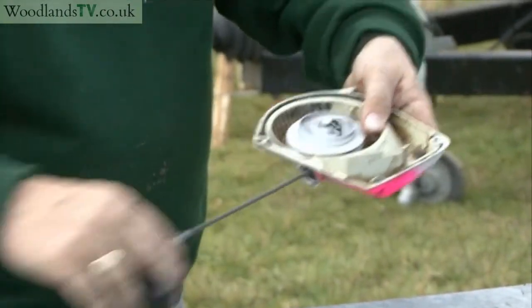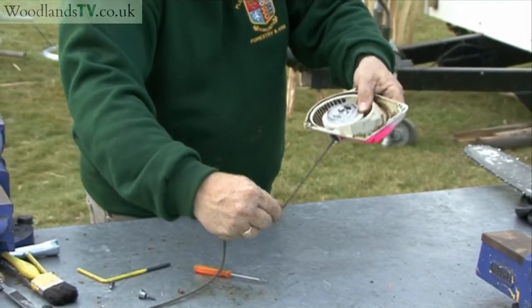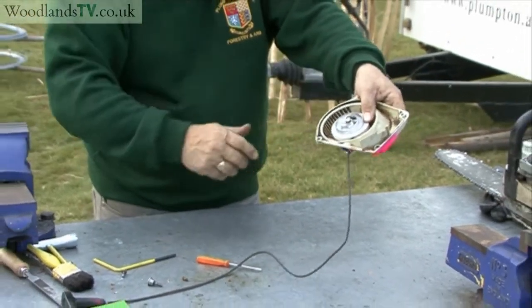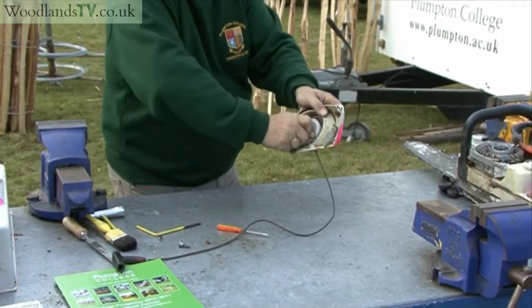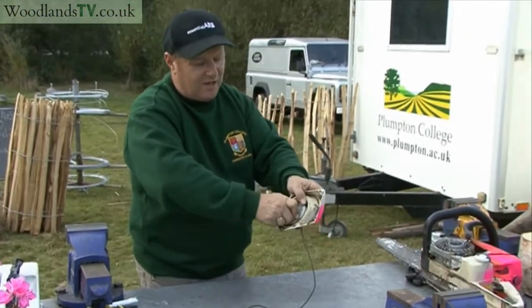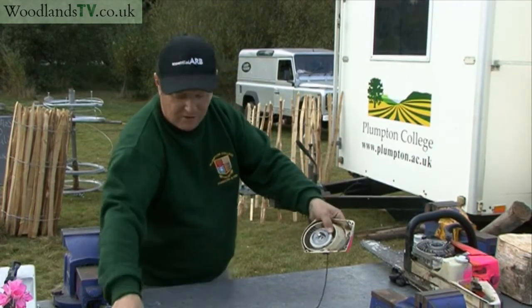To check, take all the cord off — pull the cord off like that, hold it with your thumb, pull a bit more off, that's the lot. Holding it with your thumb you need a fair bit of pressure because the spring is quite strong. You then grab hold of the spool and see if you can turn it against the pressure of the spring — you need to be able to turn it at least a quarter turn. If it's solid, the spring is bound up and it will break when you try to start the saw. We've got that little bit of extra movement there, so we know it's going to work okay.